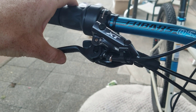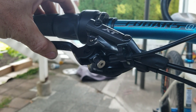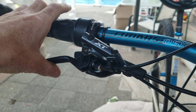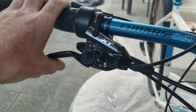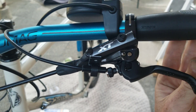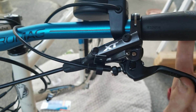What I've done is basically super glue the magnet onto the end here. So that's the open position — the motor would be cut out — and that's the closed position right next to the sensor, which would enable the motor to run. It's nothing fancy and I'm going to leave it like that for now and see how it works once the motor is hooked up. I'll probably figure out some better way of mounting the sensor because I don't think the sticker is going to last very long if it starts raining. I've done exactly the same on the other side — you can see it opens and then closes.